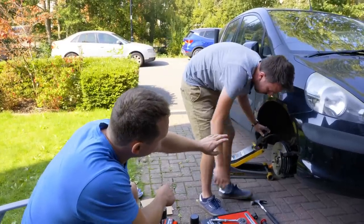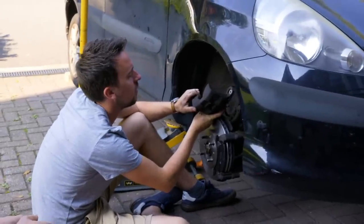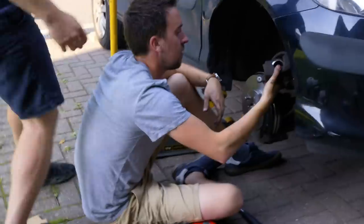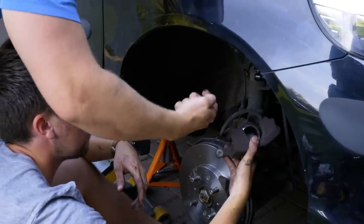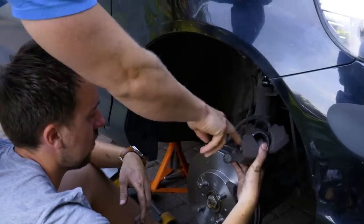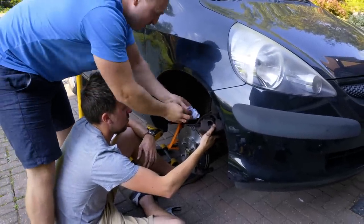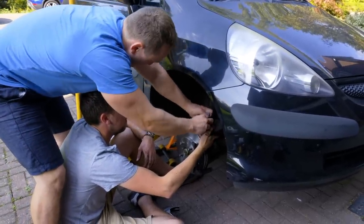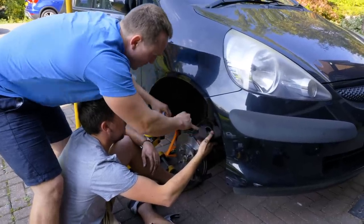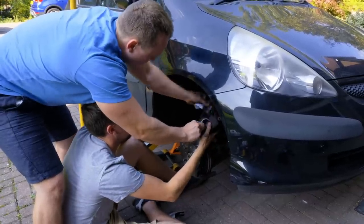All right, have a look at the piston in there. First things first, let's have a little inspection of the piston. That big metal thing. How's it look? Fine. Look, this is all a bit gunked up as well, that's disgusting. My advice would be to clean that off as well, because this slides in and out, doesn't it? So push the brakes. If you have loads of gunk in it, it'll make it more difficult. These rubbers will start splitting. So what you're doing is prolonging the life.